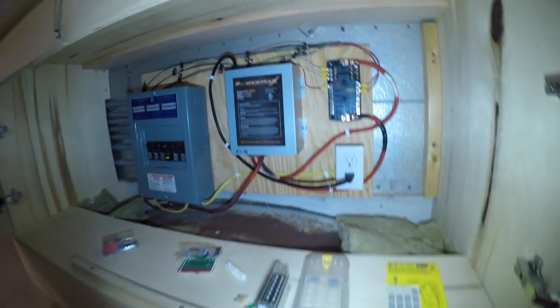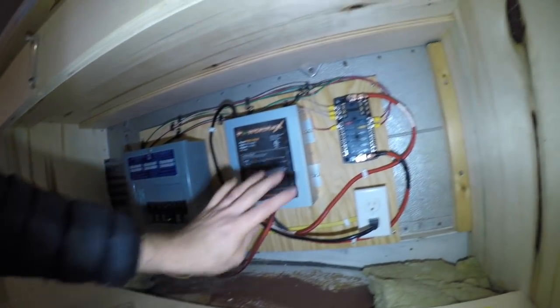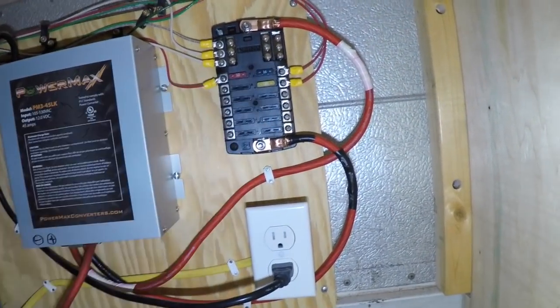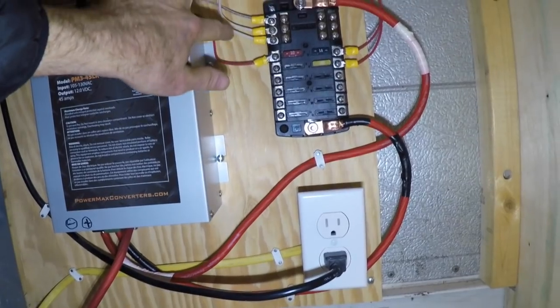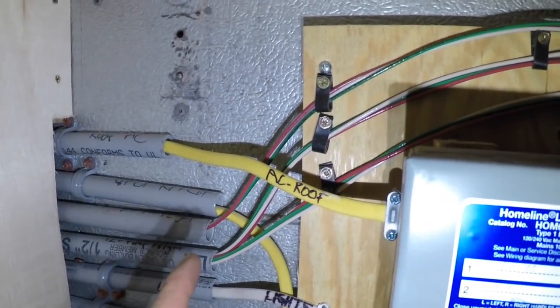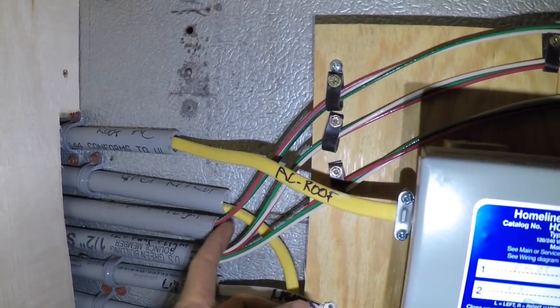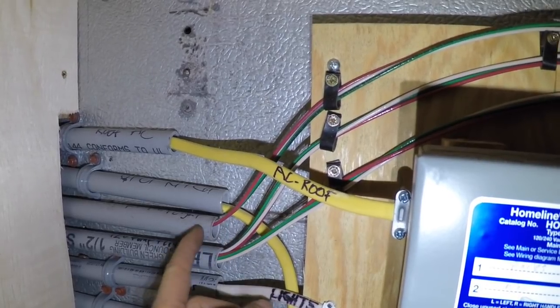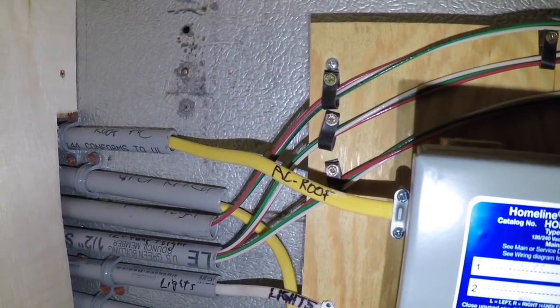I've got a little bit of a predicament with my 12-volt wiring setup. When I set it up I created 4 twelve-volt circuits, and you can see I've got 3 hooked up right now — 3 fuses, 3 white return wires, 3 red hot wires. But there are 4 circuits. Somewhere in my conduit, I've got 3 twelve-volt circuits coming out, but one conduit is supposed to have 2 coming out — so it's only got 1. There's another one somewhere buried back in that tube.